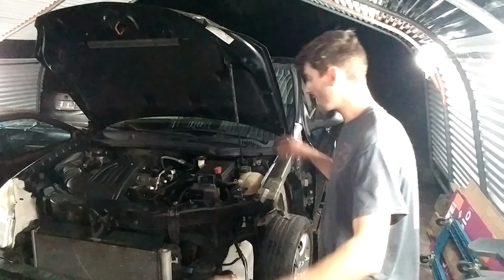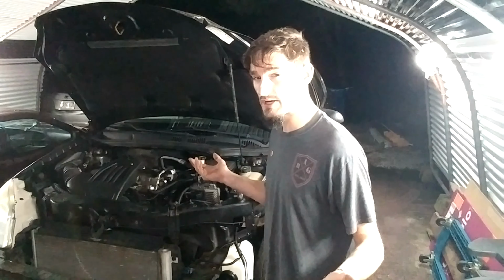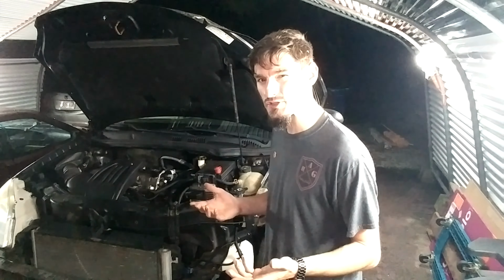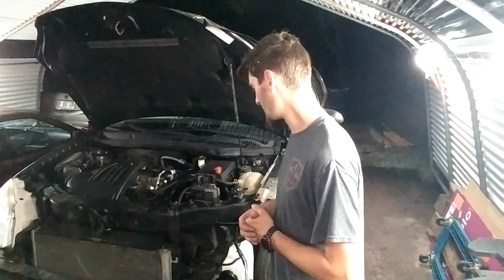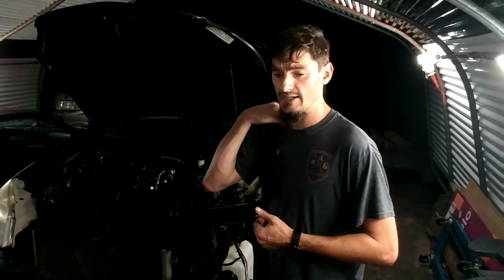And on the brakes, I did put fluid in it. I pumped it up. I wasn't losing pressure, so maybe it was just low. But I really didn't have all that much brake pressure when I was moving it a little while ago. So I want to look more into that tomorrow when I have an extra set of hands and some eyes to go ahead and turn the car on, pressure test them, hold it, and see if I can see where it's leaking, if it is.